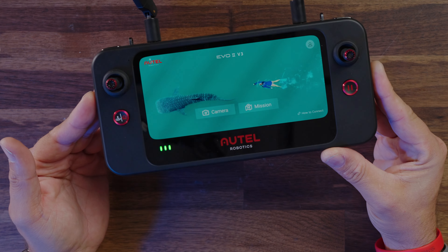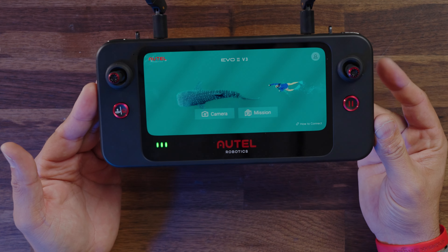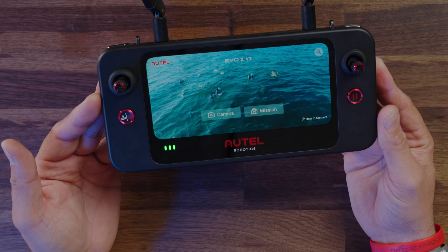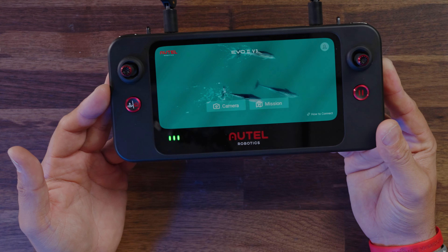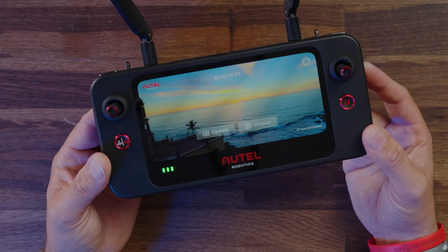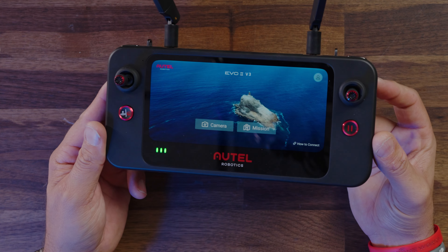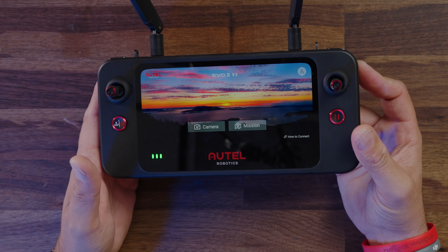Some of you may gripe at that, but considering the size of this, there is a trade-off: 800 nits versus battery life. This lasts about three hours on the 1900 milliamp hour battery. There are definitely some trade-offs happening here, but using this at 800 nits, I felt like it was okay. It would have been nice to have 1200 or 1500 nits of brightness, but I was able to get by with the 800 nits, which was perfect because it's 800 nits sustained brightness — meaning it's not dimming, it's not fluctuating. So that's something to take into account.